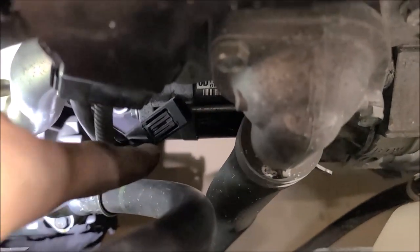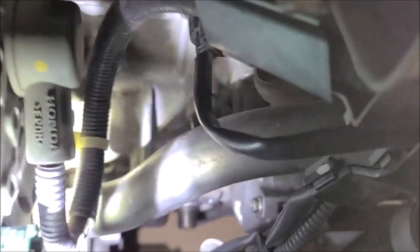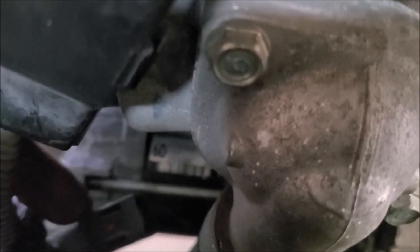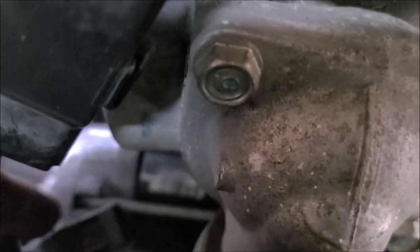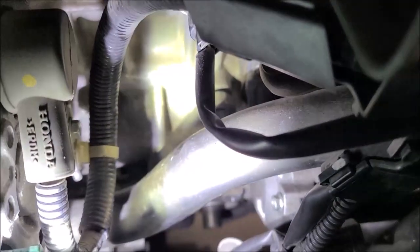All right, the next tricky place is these two little connectors. You've got that connector that goes on your solenoid. The other one, I believe, is an oil pressure switch, which you can see the switch right there. And the connector on the solenoid, you can't really see once you get the starter installed, but you can feel for it. It goes right above that decal. Just push those in until they click, and you'll have that part done.